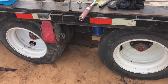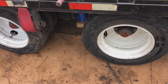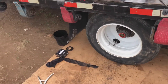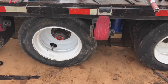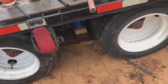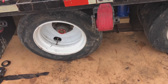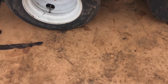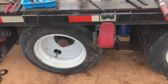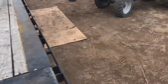All right, we are done. Make sure you check what type of hubs you've got and the size of wheel, so you can get the correct torque specs. Mine are 190 to 210 foot-pounds — I like tightening everything to the high side, so 210. We're done. If y'all have any questions, drop them in the comments and I'll get them answered.